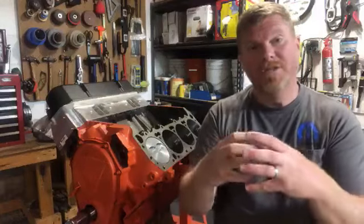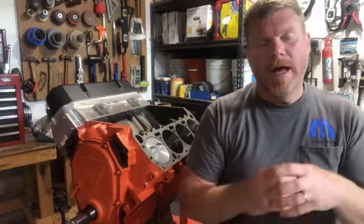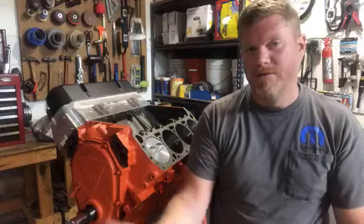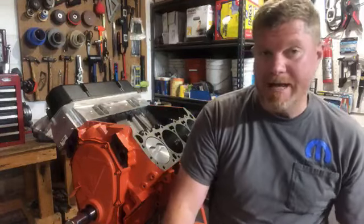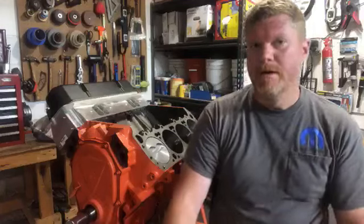Compression helps in the efficiency of that burn. The problem is that you start getting into more sensitive areas and then normal Joe Blows can't enjoy their watercraft because now they've got a really finicky engine that starts pushing out head gaskets and starts eating valves, and now no one will like your engine. So they try to keep those compression ratios pretty standard.